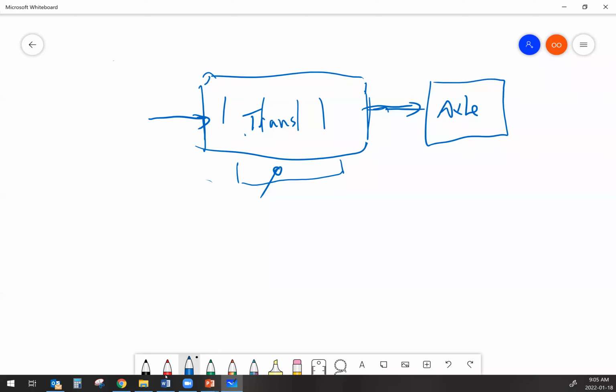Has anybody here ever driven an old, say, 3-speed power shift 970? Old Case? Okay, I'm going way far back here. Some of those old power shifts, if the shift modulation portion of it wasn't working properly, they'd nearly lift the front wheels off the ground when you made a shift. Right? So it's very important.